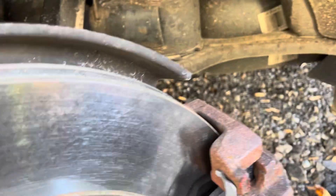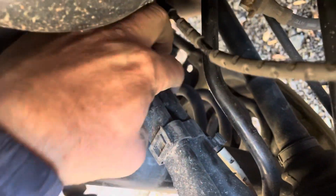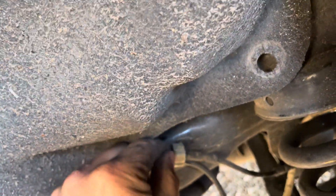The speed sensor with the white wire follows right back to here. You also have the ABS sensor right here that goes into the brake caliper. In order to take that wire out, you need to open these little tabs — it's basically as simple as just pushing them in and down. You have to take out the brake wire; there's one in the front and one in the back. Move the brake wire out of the way in order to get to the speed sensor wire, and that comes around another clip back here and another clip right here.